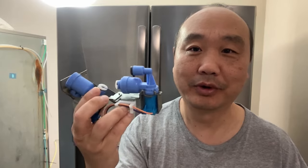Anyway, I fixed the water inlet valve — I replaced it. And I did find the cause of the cooling problem: this fan was burnt out. You can see you're supposed to be able to spin it freely, but no, this fan does not.